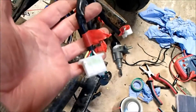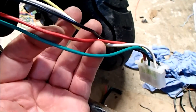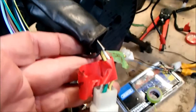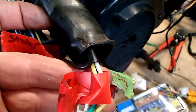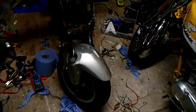The next job is the rectifier — we've got to somehow move it under the seat. Black, red, and green — power from the switch, permanent power, and earth — are already under the seat where we fitted the ignition switch. I'm going to trace the yellow and white wires, which I've tracked down to the stator. We should be able to feed these cables back from the front end and straight in under the seat, lose some cabling, shorten it down, and hopefully junction it off and back up with the rest of the loom.